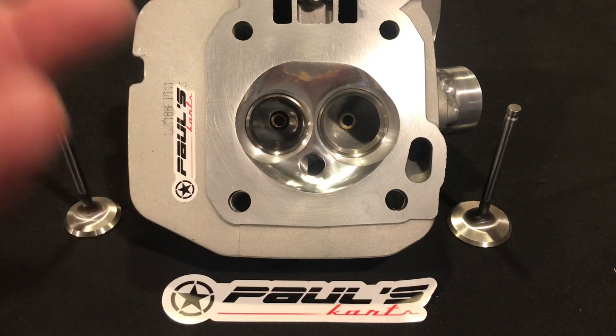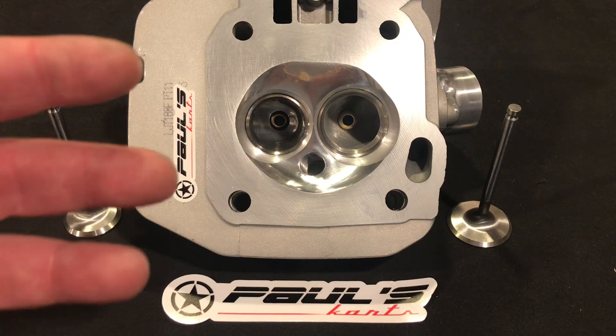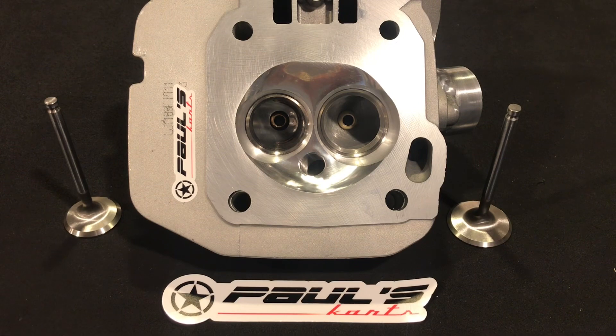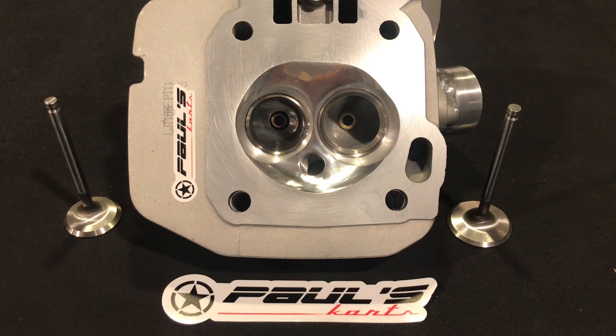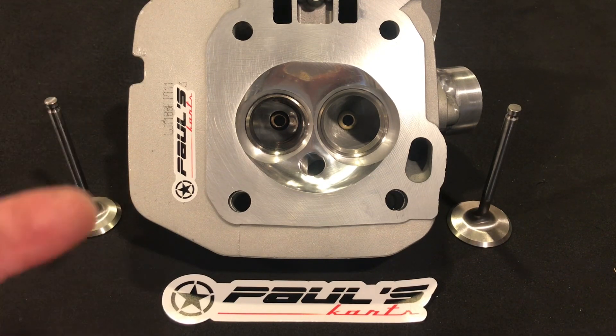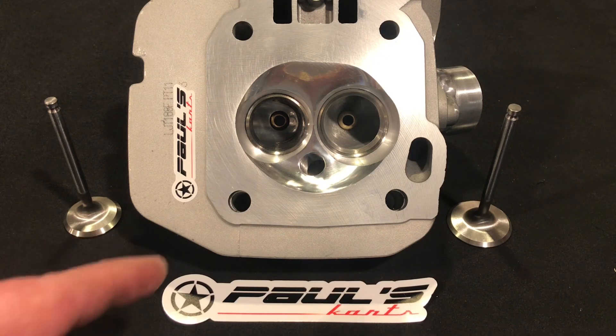That's why we went to such an extent and time-consuming process to bring those custom seats to the market in the small block stuff. Everyone says they have non-matching seats too, but they're just using other standard seats that are out there. When it comes to a 32/28 seat setup, we've worked with the IDs, the seat material, and other factors besides just the OD of the seat to get those seats to work so well. So enough about small blocks — back to the big block.